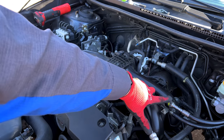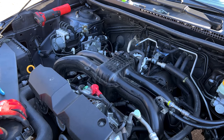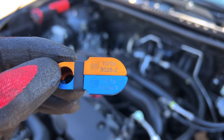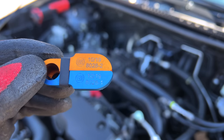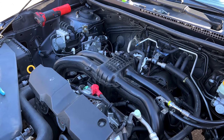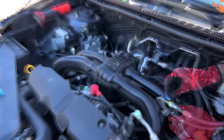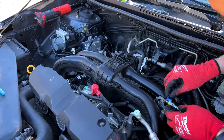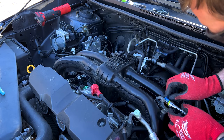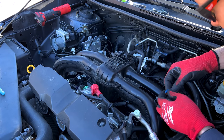Next up we need to remove our fuel hoses. These likely will have fuel pressure in them, so be wary of that when removing them so that fuel spray doesn't come out and hit you. To remove the supply fuel line we need the AST8028 tool, and it is a good idea to go ahead and pop open your gas cap just in case, because sometimes these things will pressurize and want to keep leaking fuel out of this hose. Opening the gas cap can help bleed off that siphoning effect so you don't drain your whole gas tank out.